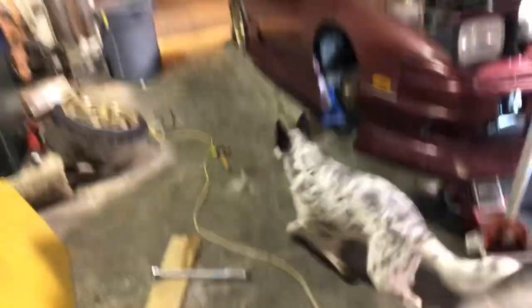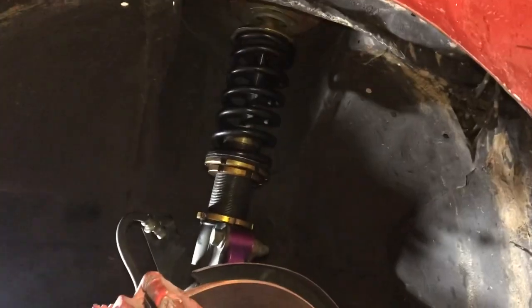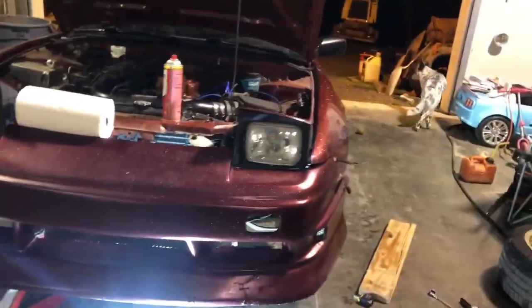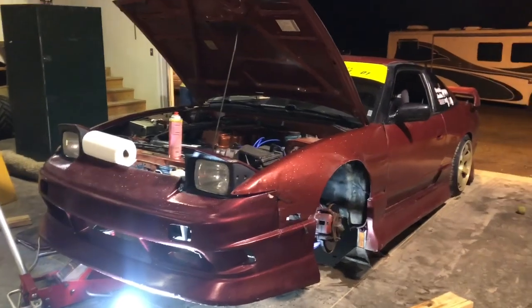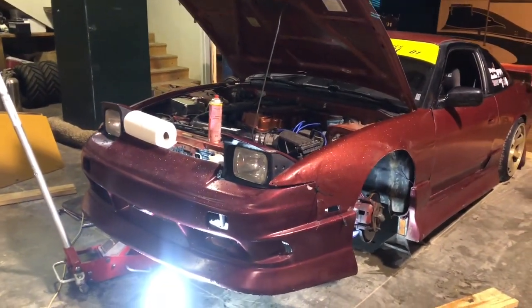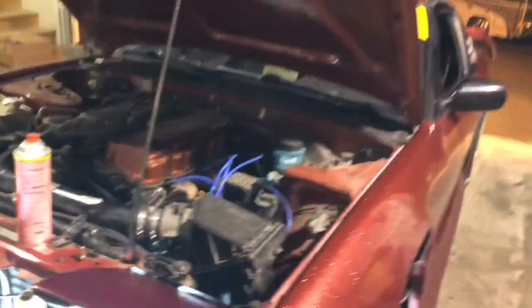This thing is really in some bad shape. Managed to find another issue — going through and re-torquing everything on all four corners, and this shock's spring had managed to wind itself down to right about here, so it had a whole lot of slop in the top. I was torquing the lower strut bolts and the whole strut just moved up on me. Had to redo that and reset my ride height because the collars between the spring and perch were even, but obviously the shock was not in the same spot relative to the spring. Got that all sorted out, front side thoroughly torqued. Going to check through the engine bay, check all fluids, make sure the major leak in the front is still just the power steering.